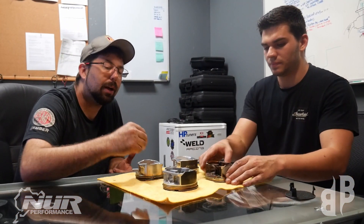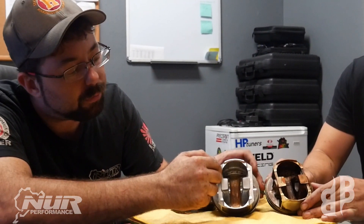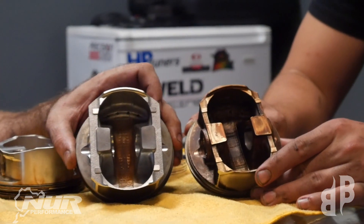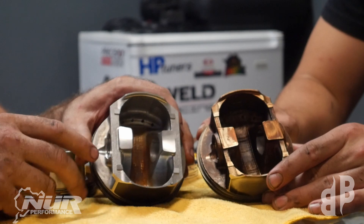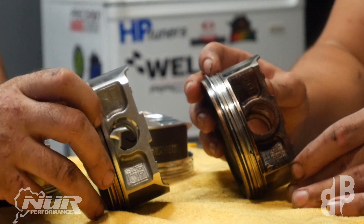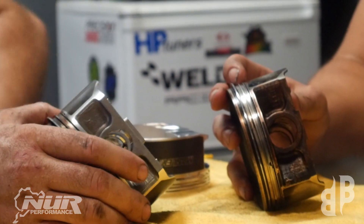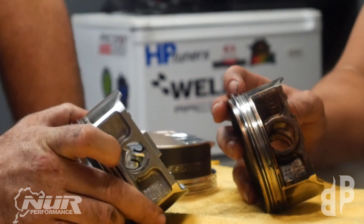I do agree with you in that assessment. The piston has been reinforced. These struts that basically go up the side here, they give you a little bit stronger support for the skirt, so the piston rocking in the cylinder doesn't damage the sleeve of the skirt. It's a nice upgrade. They also added some material right here underneath the wrist pin, and that helps on heavy decel where the rod is pulling the piston down — there's a little bit of extra material to keep from pin deflection inside the piston. So that's a good upgrade.